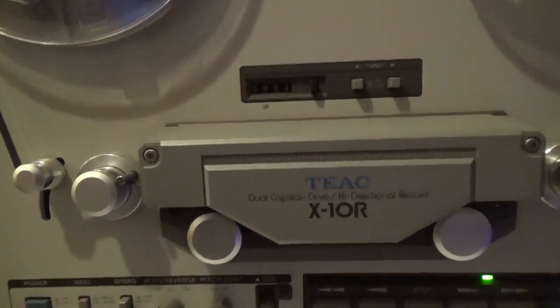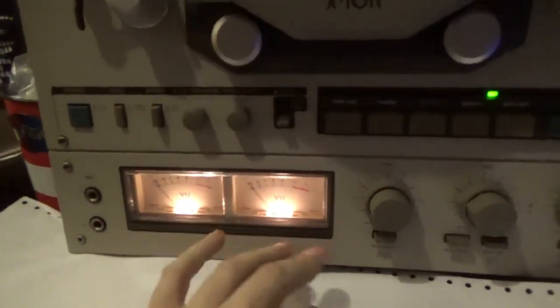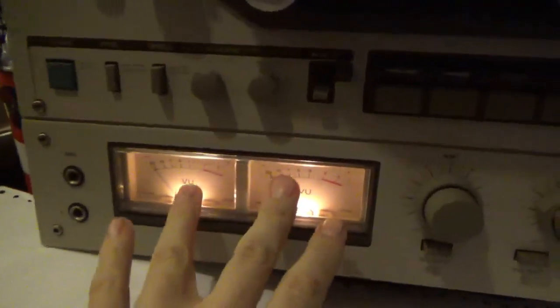This is the correct thread path — I looked it up just to verify. Make sure it's between those two little pins, because when these drop down the machine shuts off at the end of the tape. Without erasing anything, press the record mode — now you see that's flashing to let you know it's in standby — then press and hold record and hit play, and then it's recording. That way you can't accidentally erase over the tape. As for record bias and record equalizer, different machines are also fussy about sound level. You want to try and get it somewhere in the middle; you don't really want to go into the red or you'll over-saturate it, so somewhere in the middle is where you want your levels.